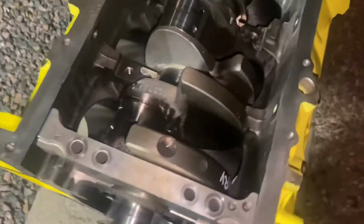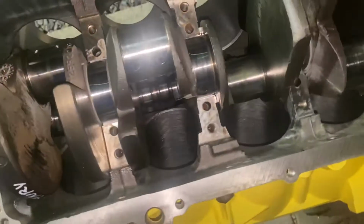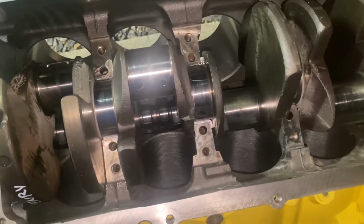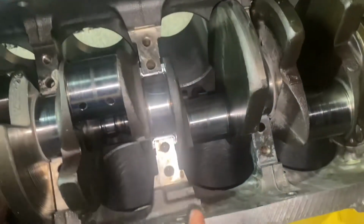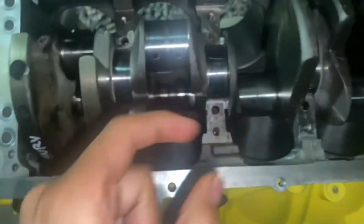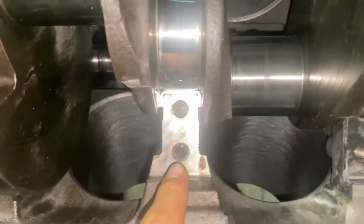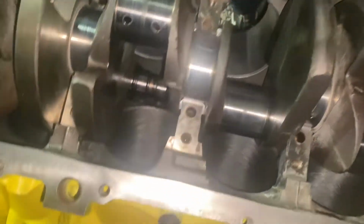Alright guys, here's the next day, and take this as a lesson to always use the proper tools even when you don't want to. We were trying to bypass the torque angle, and I tried to convert it to foot-pounds. These two at 65, they did fine. I took that one to 65, did fine, and then when I got to this one, I heard a little pop, and I was like, damn. I took it out and it came out fine, but it was a little bent. So I put it back in with the speed wrench, and as I was trying to tighten it with the speed wrench, I heard a pop, and then there it snapped, and it left the stud inside, but luckily it wasn't tight, so I got it out. And well, yeah, just take that as a lesson to use the proper tools.